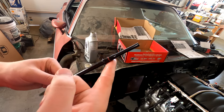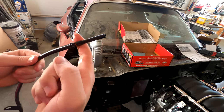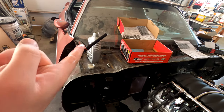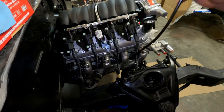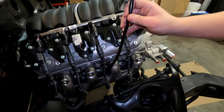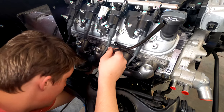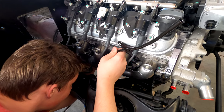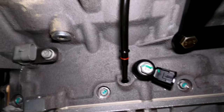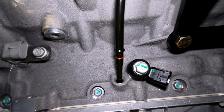We're putting a little bit of oil on the O-ring, because the last thing you want is for it to catch and get torn as you're putting it in. We're going to put that dipstick back in. We're not quite sure whether the dipstick tube is just not bent right or whether maybe there's a trick to installing it. This is a very close look at our dipstick tube.